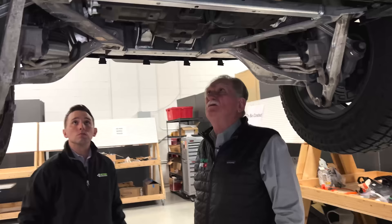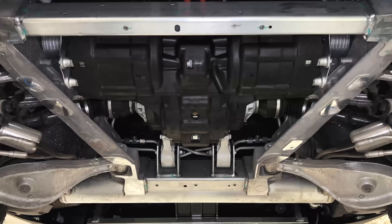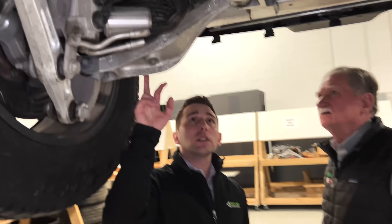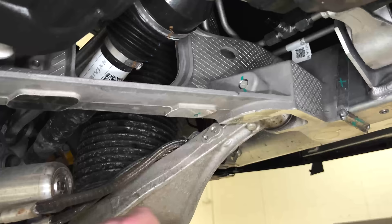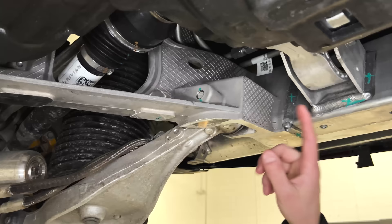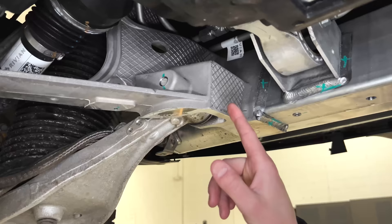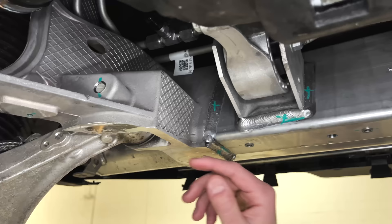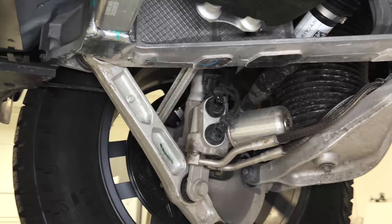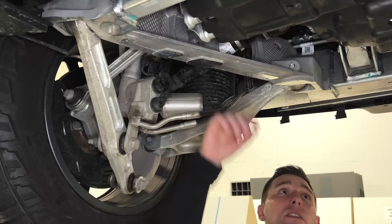If you look here, you've got the two motors for the rear. Looking at the rear suspension, it appears to be either a low-pressure permanent mold casting or sand casting — probably low-pressure — for the side node on the subframe. In contrast to the front, you'll note there's hardly any TIG welding; only where the extrusions meet other extrusions or the casting itself. You get a ton of feature integration there, and as this is a nexus for two of your fore-and-aft control arm points, there's a lot of load being transferred, so you get a really high modulus from a big casting like this — great for suspension dynamics and tuning.